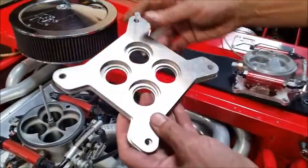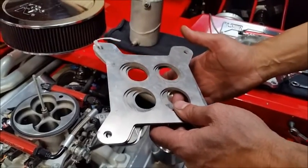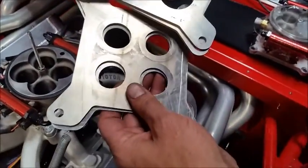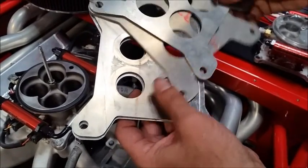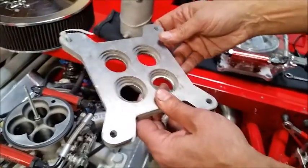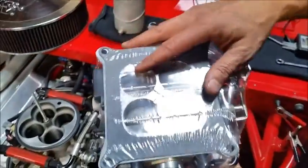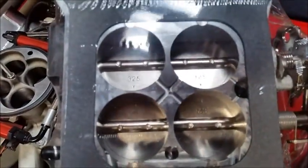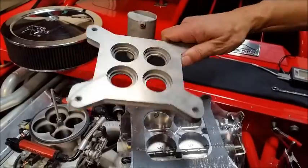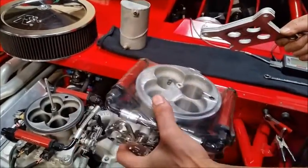What we've done is gone to a restrictor plate package. We're building one engine and a backup engine, and we're going to keep this high-horsepower engine in at both the small and big tracks, limiting its horsepower using a restrictor plate. I'd like to thank Thunderbird Water Jet — one of our sponsors — for cutting these out. They do really nice water jetting work. What's really nice about the FAST system is the throttle plate is located high up in the throttle body, so when you slip one of these restrictor plates in, the butterfly doesn't come past the bottom of the base. You can lose 50, 100, or 150 horsepower very easily.